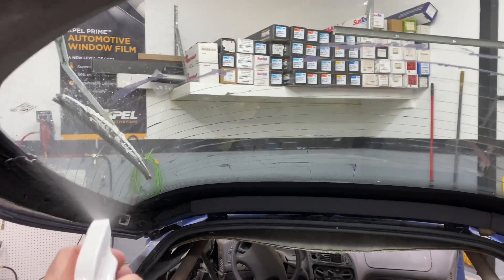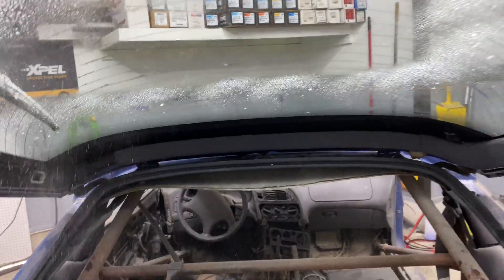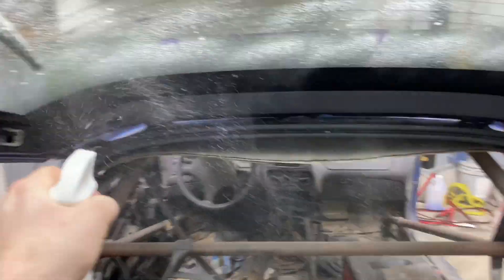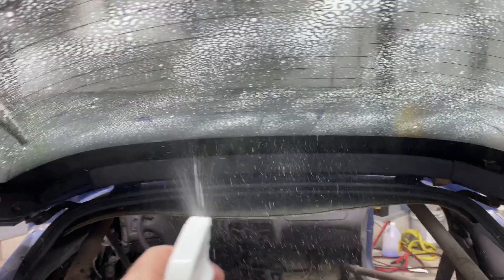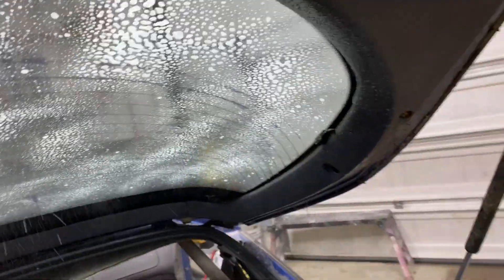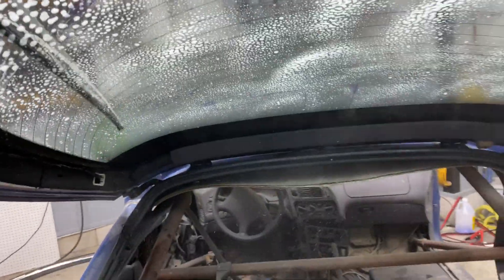Here we go with the Fusion Epic Orange, which works great for this exact purpose. We're just going to spray it on the window. I highly suggest that if you are doing this and your car is in good condition, please do cover the back hatch area with a drop cloth or some plastic so you don't get any of the adhesive remover on it. While you were doing the steam, you don't want a ton of water inside the vehicle. Also, if you do have fresh, nice interior panels, try not to get a lot of the spray on them — wipe it away before you clean it all up.